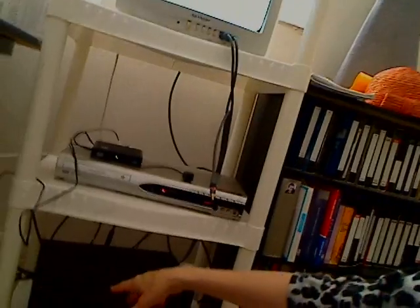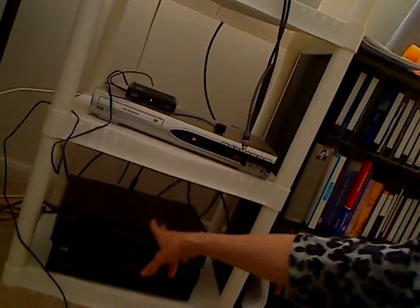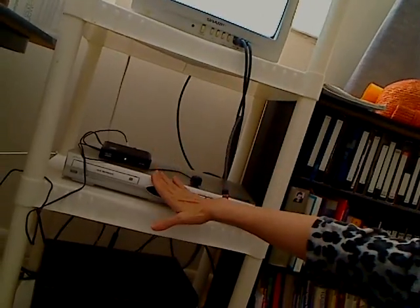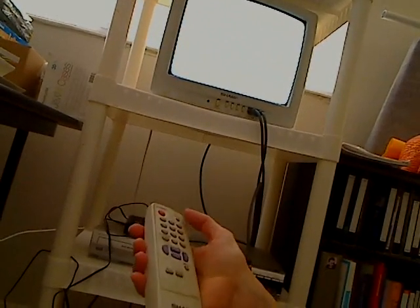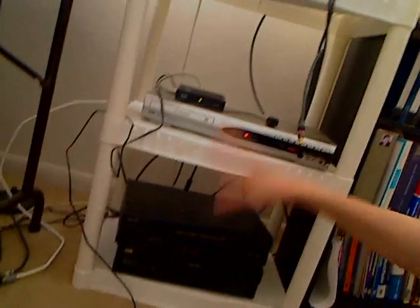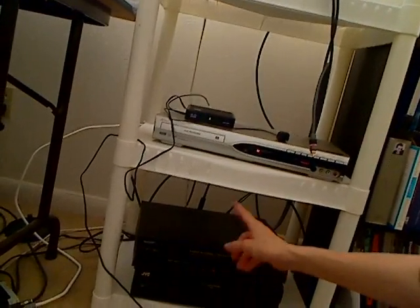And they will be dubbed onto the VCR. It took me forever — I was all hung up because I kept trying to get the channels to set on the VCR. Apparently the digital signal is not compatible with these old-fashioned VCR players. So if you want to dub, the picture is going to be coming through the channels on the DVD. As long as you've got your channel set on your DVD recorder, you don't need to worry about setting the channels on the VCR — as long as you've got it hooked up the way I said. Then once you've got your channel set, you hit input on your remote once and then again, and you're going to see pictures both times — your television picture, then your input picture. And then you know you're set up right. Then follow the instructions on your VCR for how to dub and how to use your timer recording. With timer recording, for the channel, you use AV.